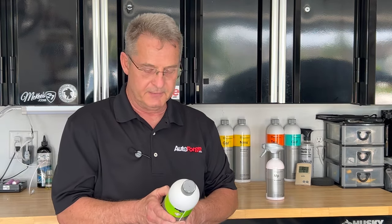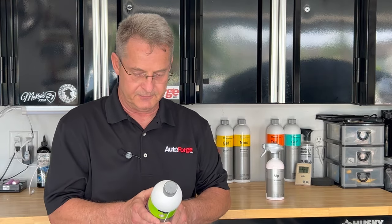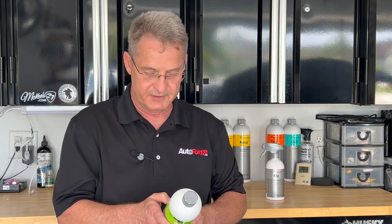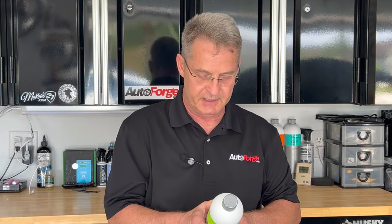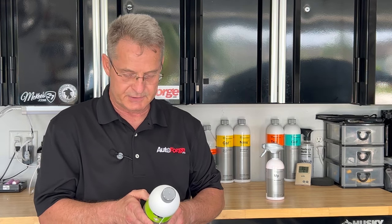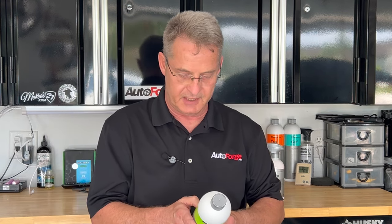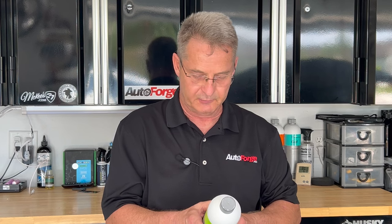So the recommendations of how to use this product, depending on the dirt accumulation, cleaning vehicle exteriors and engines, use a dilution ratio of 1:5 all the way up to 1:30. It says to apply the product over the whole surface, allow it to react for a short time, and use a high pressure cleaner to rinse off thoroughly.